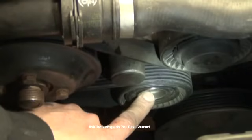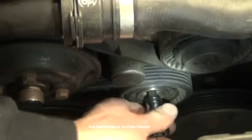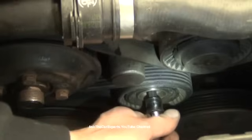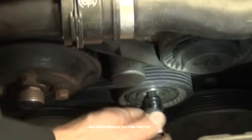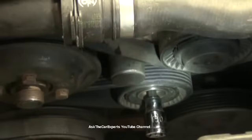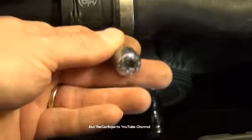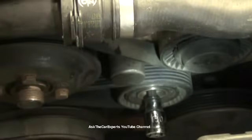So this pulley right here may be an Allen or it may be a Torx. I think this was an Allen, but I had started with a Torx, so it actually took the shape of a Torx. Also, that pulley is failing on my engine, so I have a new pulley that I purchased right here, which I'm going to be installing, which is nice and smooth. That one has some tone to it, and the new bolt, which you can get separate, is actually a Torx as well. So this is going to be the replacement, and this I have the hydraulic tensioner.